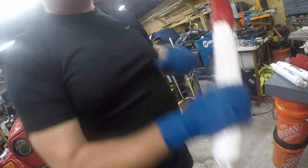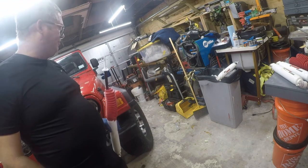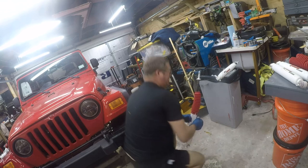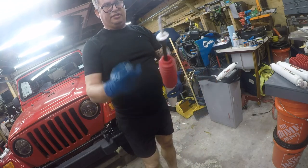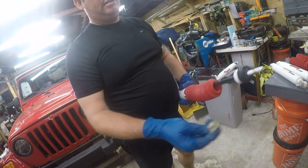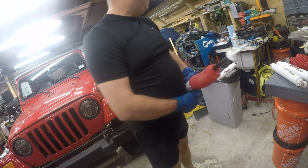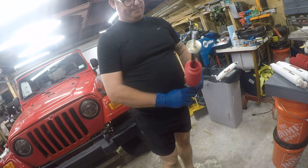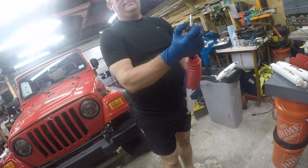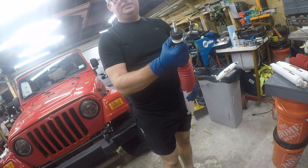It'll fix when we put it together. I've got to find the pieces that flew all over the floor - oh there they are. This is really not that big of a deal. You just slide this over, leave it loose until you're done. Washer with the large part up. I think this goes down here and then that goes like this, because these are what grab the frame or the mount. Anyway, let's get it installed. First things first, you're going to compress down your shock and then you're just going to pop it in.